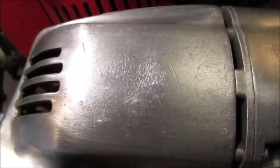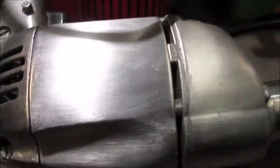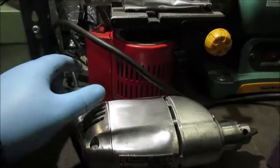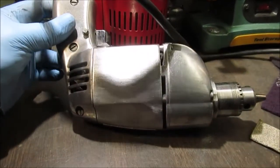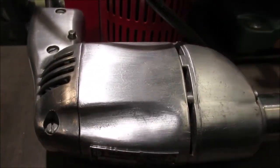I took some sandpaper to that because see all those scratches? You're not going to polish them out. I used 100 grit — it's really aggressive — but then I'm taking a brand new scotch pad to take them out and then I think it'll polish up fine. It's blowing out the camera in the light and it's not even polished yet. Be real careful — it's not a valuable antique, so I'm just experimenting.